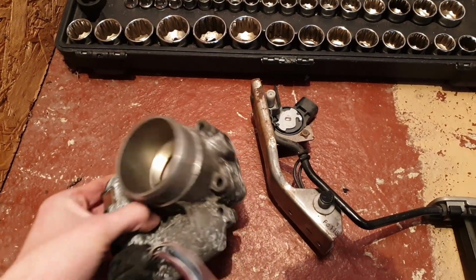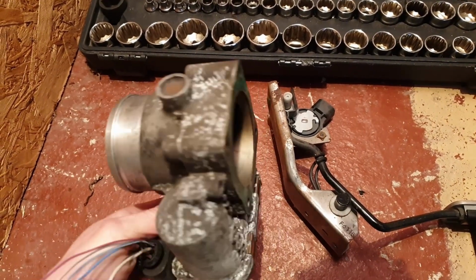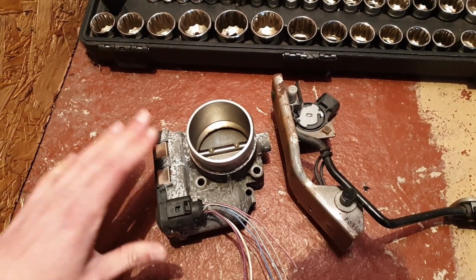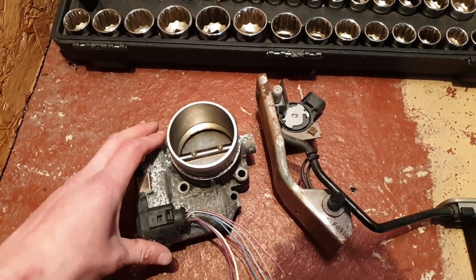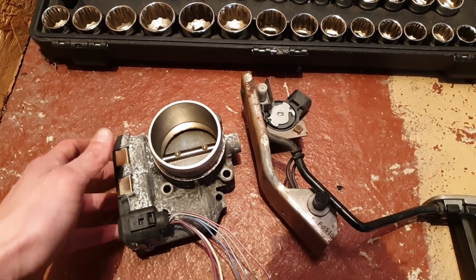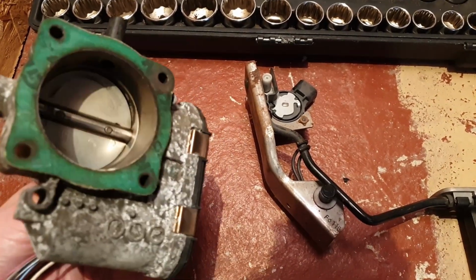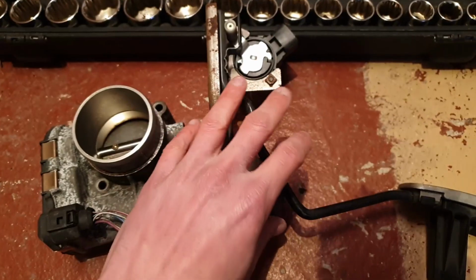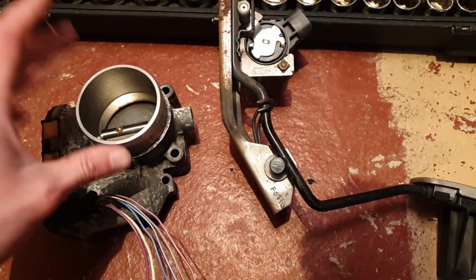Some of you may be looking at this and thinking, wow, this guy is insane. Why would he want to do that? And there's quite a few reasons why. So there's a common misconception to begin with that actually drive-by-wire throttle isn't very responsive. However, in the aftermarket world, drive-by-wire throttle bodies can be very responsive, and to be honest, it's all to do with the controller that is on the ECU. So ECU Master comes with its own H-bridge outputs, and they are capable of driving a 6 amp throttle body like this. And then finally as well, it all comes down to the pedal and the throttle body that you choose.